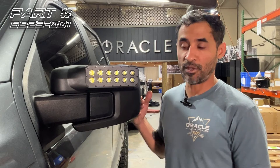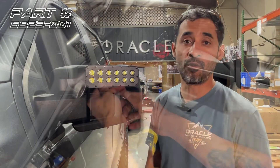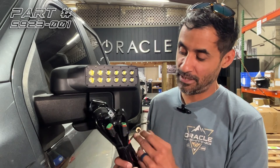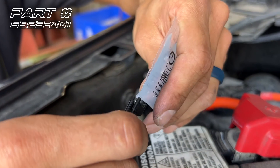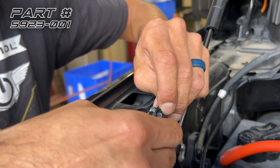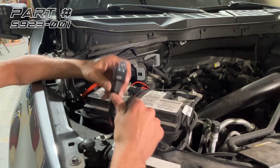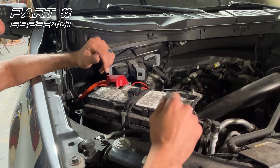This vehicle is not equipped with the puddle light and camera option, but if yours is, you can refer to the written instructions and tap into the power and ground on the circuit within the side mirror itself. If your vehicle is equipped with upfitter or auxiliary switches, you can tap into those for power. If your vehicle has neither option, we offer an off-road harness — link is in the description below — which includes a switch, a relay, power and ground for the relay, and two outputs. That's how you get power and ground to your lights. I've got my power and ground hooked up to the battery feeding my relay, the switch is in the cab, and my outputs run one to each side.